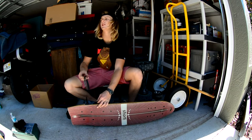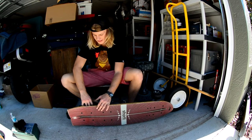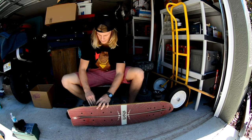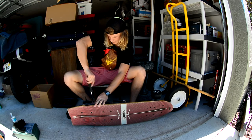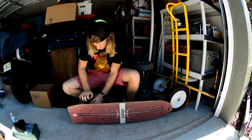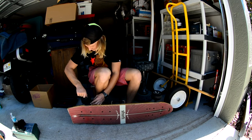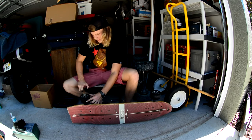Pull the belts out. If you need to throw it out, get a new one — we just replaced this so she's still good to go. Put it around the small sprocket making sure that the teeth are all lined up. I like to give it a little pull and let it spin around just to set it in. Belt guard back on. Tighten down both of the allen screws making sure it's really snug so we don't lose anything. Same thing — push down and turn counter clockwise. Eventually you'll hear it pop down into the belt. Lock nut — tighten this nut down all the way making sure that it's snug but not over tightened.